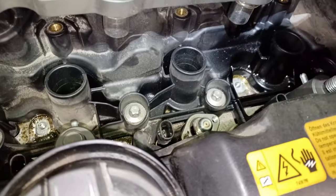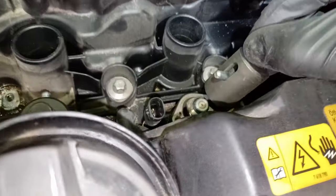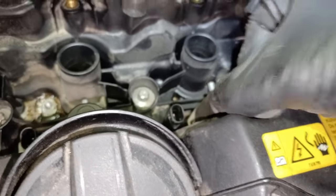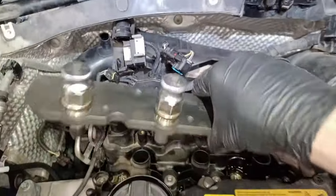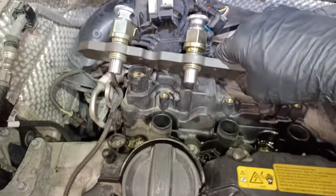So the injector's a certain particular shape. Don't worry about this thing. Just slide it on like that. Turn it 90 degrees and then give it a wiggle and it'll lock itself in. And that's all your three set up to pull them. Then we just need to put this on here like that and then use the left-handed thread to wind it on.